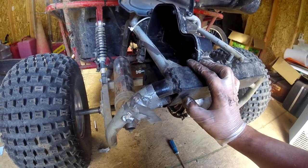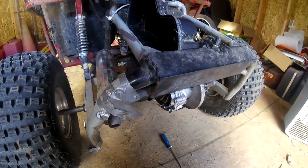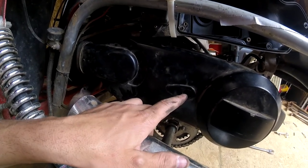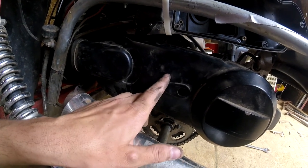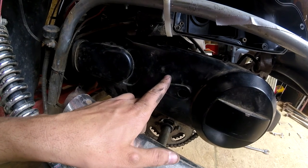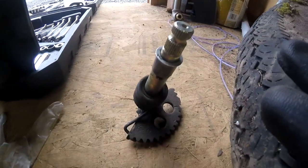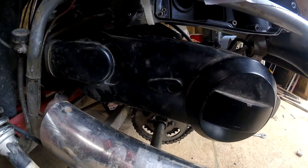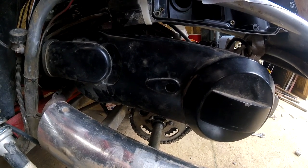When we have to replace the clutch, we'll probably put an aftermarket performance clutch in this thing. You may have noticed this hole here — this is where your Kickstarter would normally go if you had the scooter. That is the most insanely hard thing to get aligned under spring tension while this is in the go-kart. Since we can't use the Kickstarter because it's not the scooter, we're just going to get rid of it. That made it a lot easier to slide the cover back on.